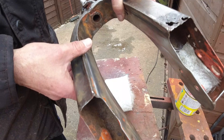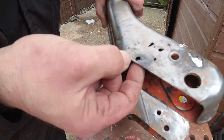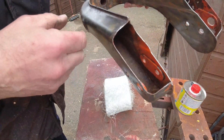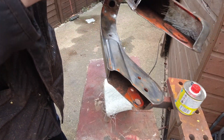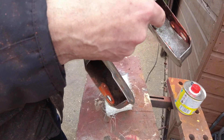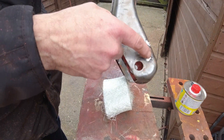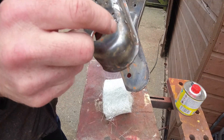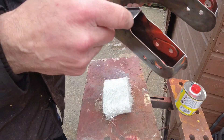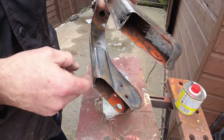There we go — that's all the paint off, most of it, and most of the rust is off as well. It has developed a few little holes, but only in these parts, so I'm actually quite confident it's structurally sound. What I'm going to do — you could use some wire mesh — but what I did with the Honda Stream when I built that panel up, I'm going to put some fiberglass in there, not for strength or anything, it just gives me a backing in there. And then once that's hard, we can fill those parts. I'll put some rust killer in there as well. So I'll get on and do this fiberglass and see how we get on.